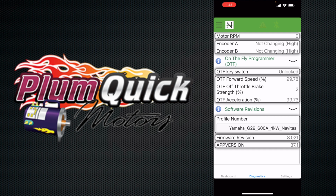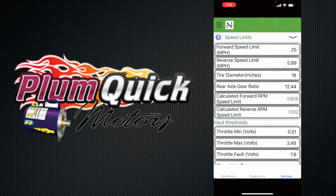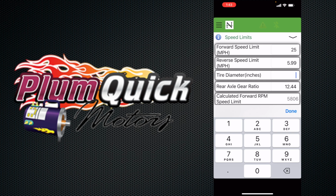So you have a profile number. It's the Yamaha G29 600 amp 4kW Navitas. Firmware revision is 8.021 and the app version is 37.1. And we go over here to settings. It's going to automatically come at 25 miles per hour and the tire diameter is going to be 18. Now these tires on this golf cart are 23, so we're going to just select right here. We're gonna delete those. We're gonna add 23, hit done.